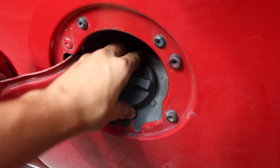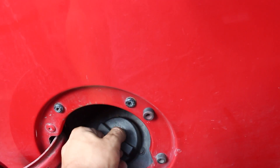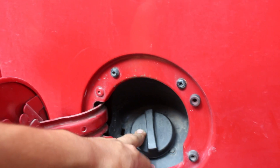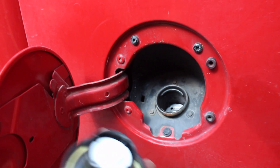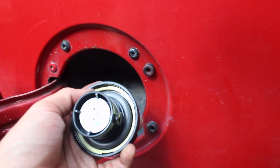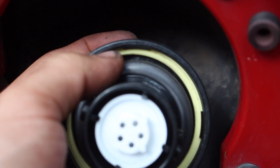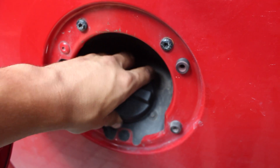Can you see this — see how it's moving? That is not adequate enough; that does not look like it's going to get a good seal. That is loose. Go to your parts store and get a new gas cap for your car. Not every one is the same, so replace this one with a new one that perfectly seals this area. Because there's a leak, that code is coming up. The little rubber ring here should make a perfect seal around the opening, but because it's not, even when you click it on, it's not making a perfect seal, and the engine light is coming on giving us that code.